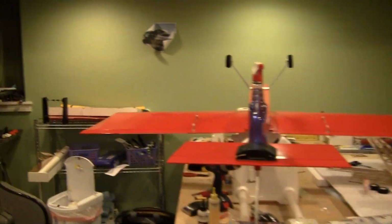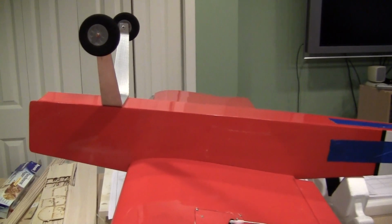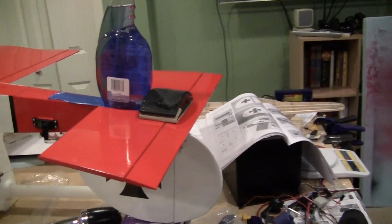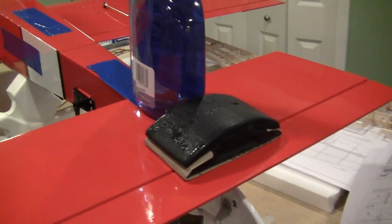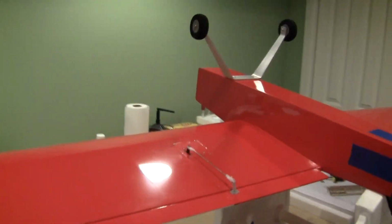It's just past midnight, and I'm gonna call it a night or morning, whatever. A pretty good start, and I'll still fly it tomorrow. So let this dry overnight. It has 30-minute epoxy on it, horizontal stabilizer. Then in the morning I'll connect it up with the servo, mount the receiver, and I'll do all the drilling and stuff to mount the motor.